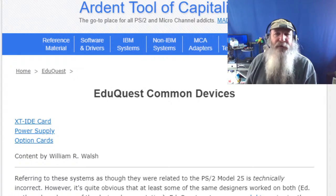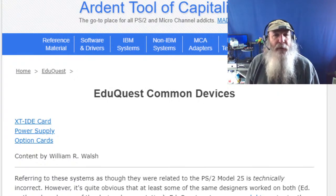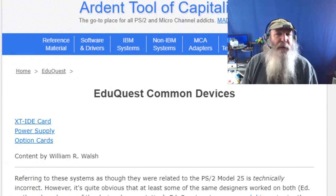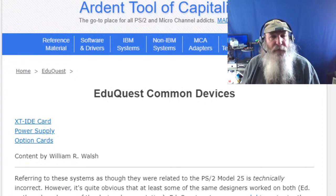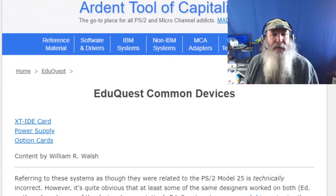And then they had Micro Channel that they supported, with companies out there that were networked together with token ring, very intricate and involved networks for that time. And then token ring went to the 16 megabit standard as well later on. And they even have 8-bit adapters that are 16 megabit token ring boards.